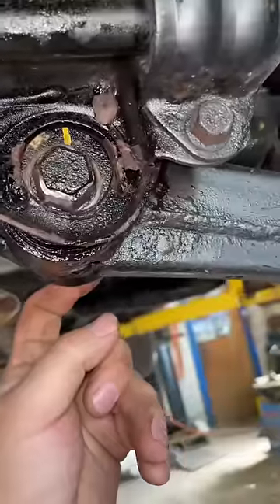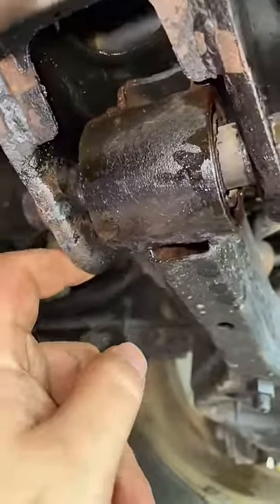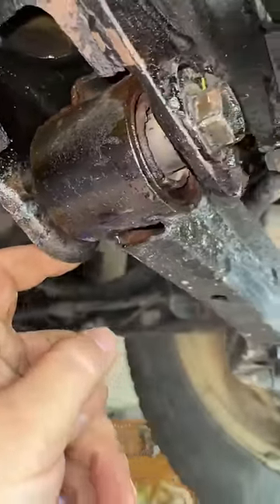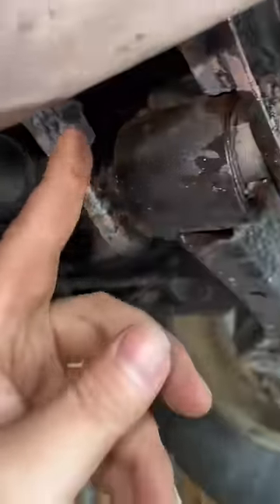At this point, the best thing to do is just chop off both ends and press your chopped bolt out. Alignment shop was not lying this time. I could work it back and forth with heat and all that, and I might toast the bushing — then we got to replace the bushing. I'm just going to chop off both ends.